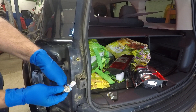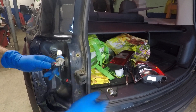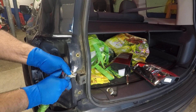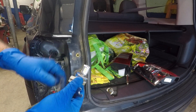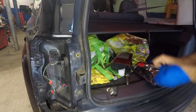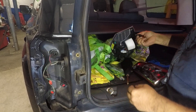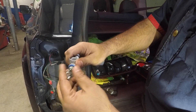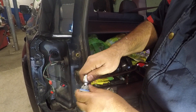This is out. What we're gonna do now is pull back on that tab, which is super hard. Probably gonna work with my little tool here. We need to get this red tab back — over time it will get jammed up from all that water in there. So we're gonna disconnect this, take off this bulb, and put it onto the new light. To take out this bulb, you just pull it. So this is a special bulb — we're gonna turn this counterclockwise. This is a regular filament bulb, so that comes out, and this new one goes in just like that.